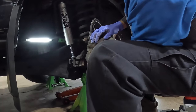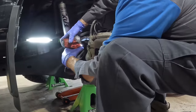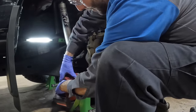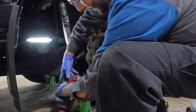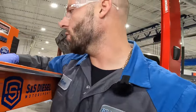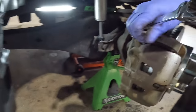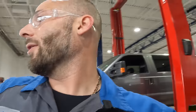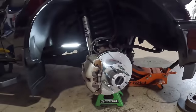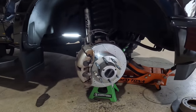We got our 16mm caliper bolts and then we are going to repeat this same procedure for the driver side. Then I am going to do the rears. The most important thing we're going to do is making sure that our braking procedure is going to be followed, because it is imperative to follow those instructions when we first start braking. There are some explicit instructions from Power Stop. Our front brake is on — let's repeat this for the driver side and then we will start the rears.